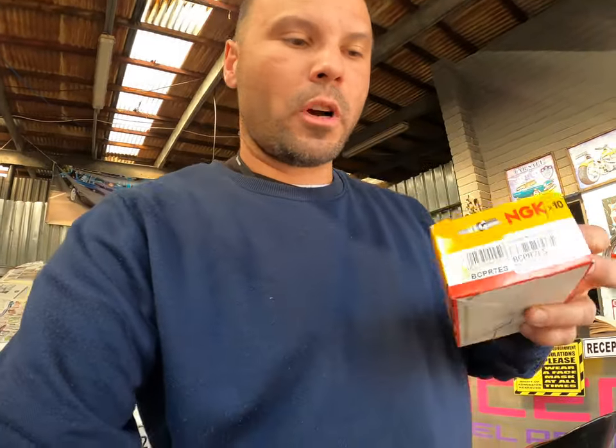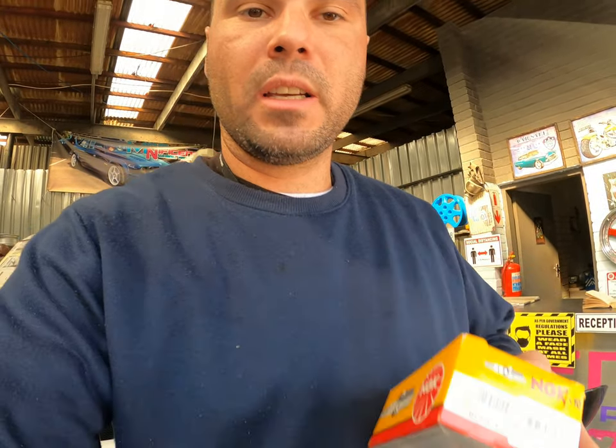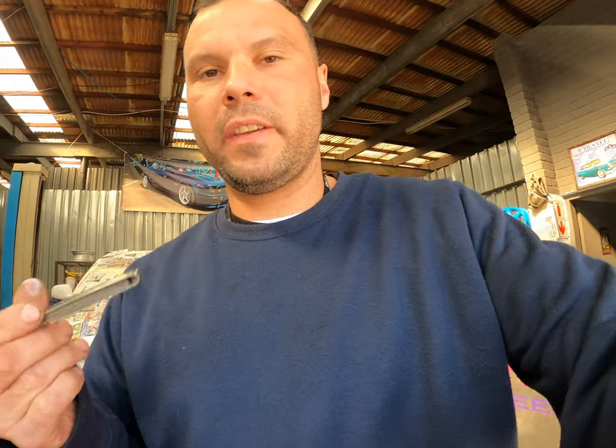What's up, guys? Today we're going to change spark plugs on an R33 GTST RB25 Skyline. What you're going to need is spark plugs, normal cheap BCP R7ES plugs, and a feeler gauge, and obviously your recommended normal tools.